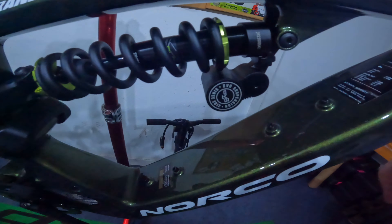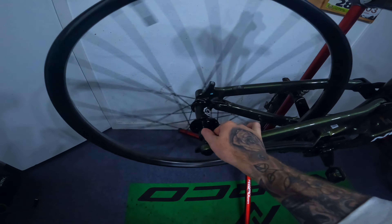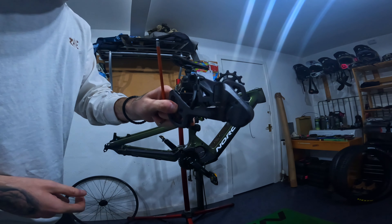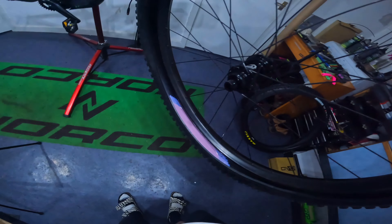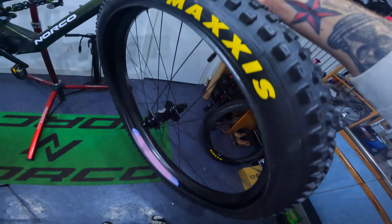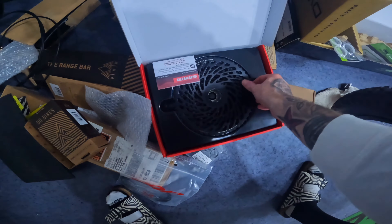Managed to get the shock installed — had to get some little hardware that was included in the box, but she fits. Then the wheels — I've just stuck the wheel in to make sure everything fits, and we've got Industry 9 hybrid hubs on here. Got the TRP derailleur — going to stick it on. This is 12 speed. It is tyre time. I'm deciding to go for a Maxxis Dissector here, which is kind of a faster rolling tyre. We've got some pink sealant in there, so we're gonna get this bead on and get them inflated. Next up we're gonna get this beautiful fresh cassette on the wheel.